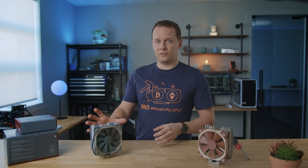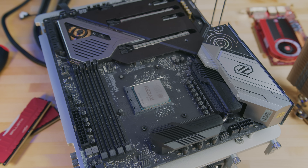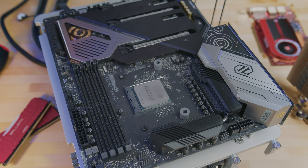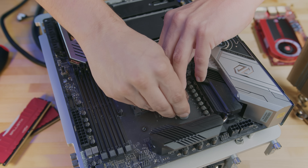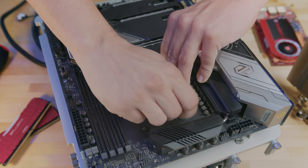To show you how easy the installation process is, I'm doing a full AM4 system install from start to finish for the U12S Redux. Installation onto AM4 is unique but follows the same path as Intel — the only difference is Intel has a Noctua-provided backplate. Here, you install little spacers, then a crossbar on both sides with separate screws. Because the AMD backplate is already in place, it just slots right in.